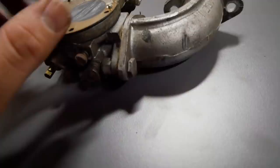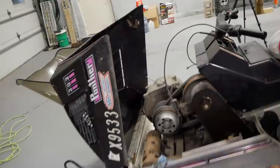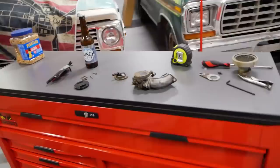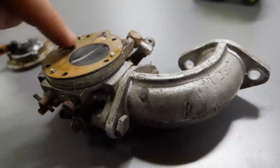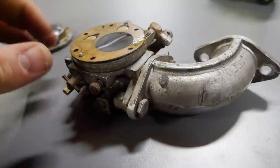Nope. This diaphragm right here is rock hard. The way this works is that there's this diaphragm pump right here on top of the motor, which has a diaphragm that goes like this inside of it. And it is fed through this tube into this chamber, which has a similar diaphragm and moves fuel through these two flappy valves right here and brings fuel into the carburetor.